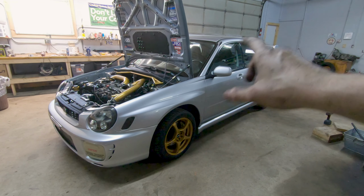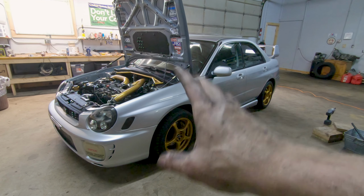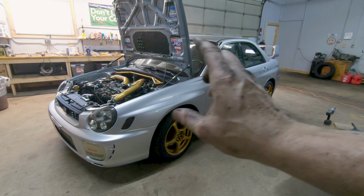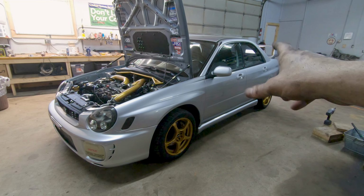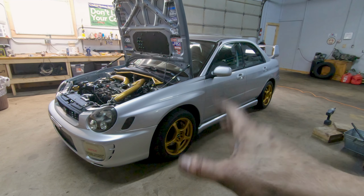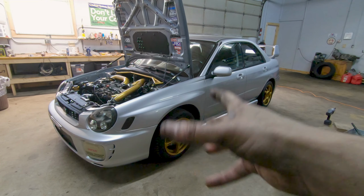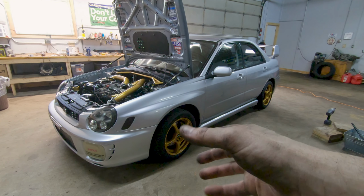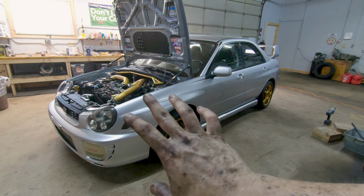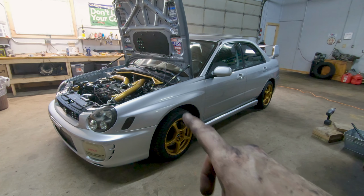We still have to put the rear seats, the interior, back together. But one thing I like to do at this point is just start the vehicle and let it run. We can kind of stick our head in the back, smell or listen or look for any fuel. We've already built fuel pressure, so it should be fine. But it's just one more thing before you get too ahead of yourself to just try to identify a leak if there is one. But I am absolutely filthy right now, so I'm actually going to shower, change, come back out, and we'll finish this up.